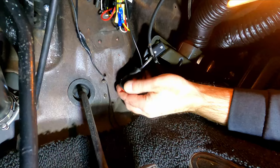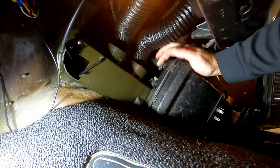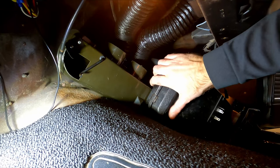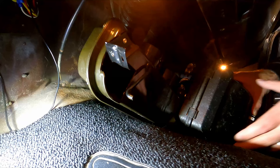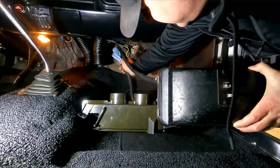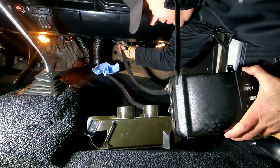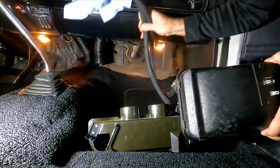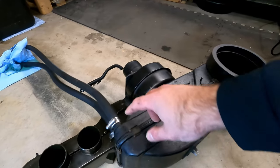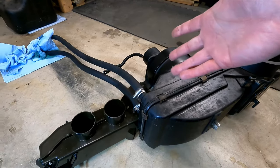I'll just take this little guy off. Now at this point you can choose to take the clamps off the heater hose right here, but you're likely to spill coolant. I'm going to try to pull these tubes through the firewall and hopefully not spill anything so we can get this box out of the car. I put a towel on the end of the tube — made it, it didn't spill anything. Actually, as I was dragging this over, I spilled a bunch of coolant on the bottom hose. So now I'll disconnect these hoses from the back of the heater core, pull those off, separate the box by pulling the clamps off, get the heater core out, put the new one in, and put it back together.